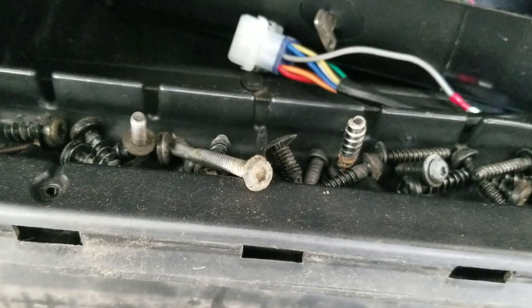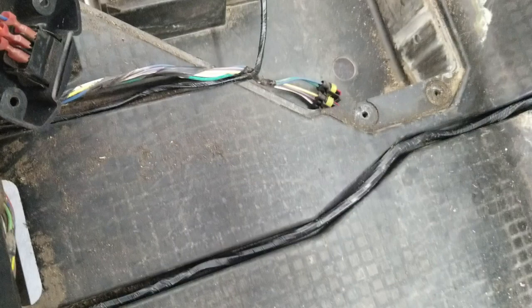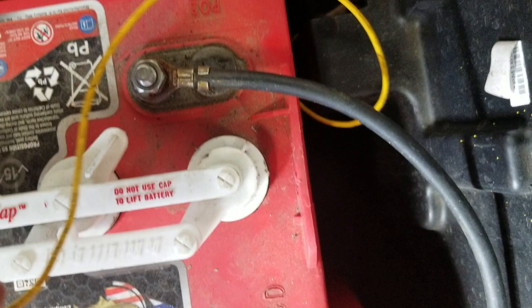There's something else I'm going to do — I'm going to run an additional single wire through here and lay it down next to this. This wire will eventually go to my key switch area; I'll explain that later. Before I close this back up, I'm going to run an additional number 16 wire and lay it down in that trough with the cable. You can see this yellow wire I ran down through there, left it up here. I'm going to be mounting a relay right here for the lights later. I put a piece of duct tape to keep it down in the groove.